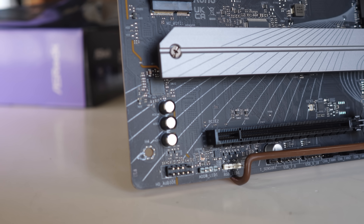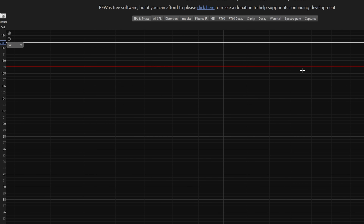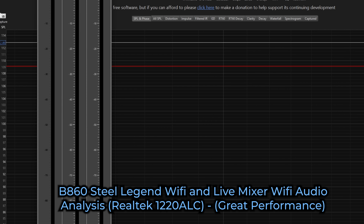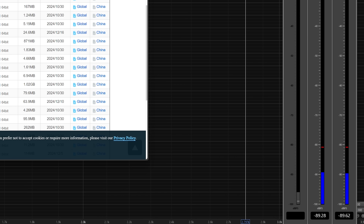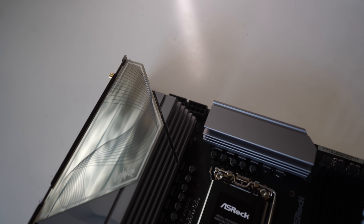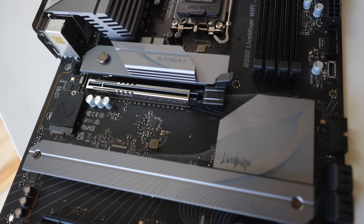The two-phase difference is a non-issue given the already excellent temperatures. Both boards share 20K capacitors, the same chokes, with MOSFETs rated at 60A versus 80A. For onboard audio, both feature the Realtek 1220 with phenomenal performance — around minus 90 decibels of crosstalk, virtually inaudible, with an extremely flat frequency response curve. Both boards also have 2.5-gigabit LAN and an easy-to-navigate BIOS for locking in XMP or Expo profiles.